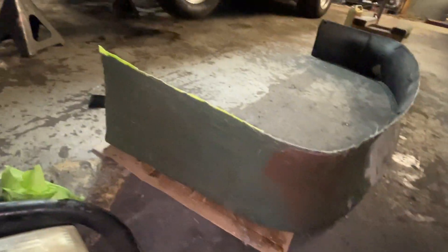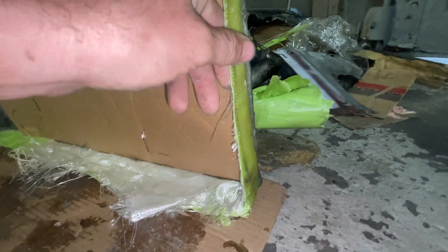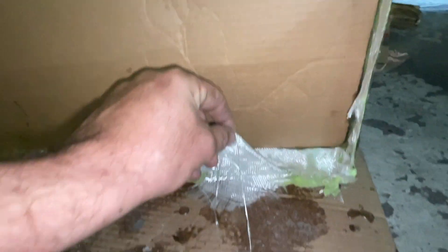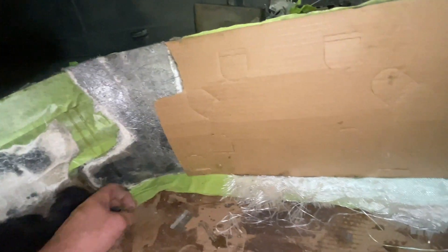Welcome back. I was able to pull it loose, pull out the front end, and we still kept our shape — that's good, all that's hardened up. See how we got the lip built there on the inside like the factory one. Yesterday I rolled it over so I got my little lip. It ain't super super strong yet but it ain't weak neither. I took all this taped up against the back of it, and now I pull this down — I'm gonna fiberglass all the way around to the edge.